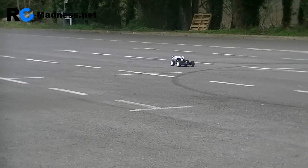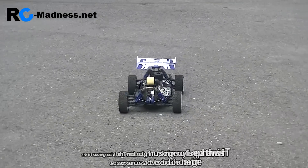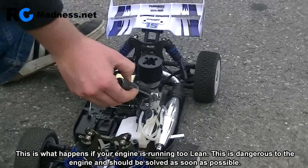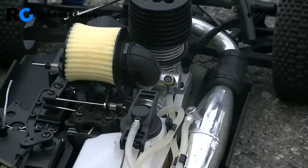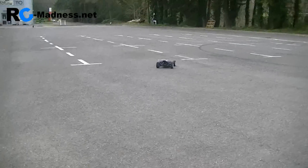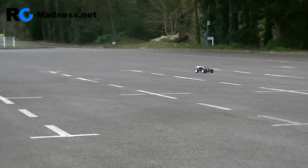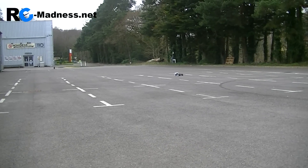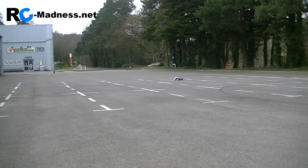Let's now see what happens if we lean the engine too much and it's too lean. Now the engine is running too lean. You can see the engine has quit because it's starved of fuel and therefore cannot lubricate the engine. That is very dangerous — if that happens you need to turn the high speed needle counterclockwise a bit to add some more fuel into the engine.